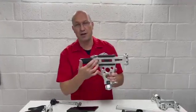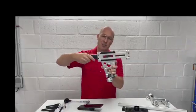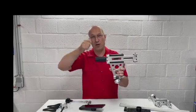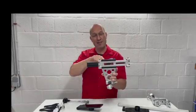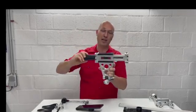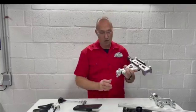There's a lot going on in this carriage — you can see the springs in here. The springs compress first while you are tensioning, and then on the end the spring keeps a lateral spring tension on the metal. So if you are hitting with a hammer or doing any manipulation — pushing or glue pulling — that spring allows the metal to move further and further out, keeping constant lateral tension. It works both ways: push or pull, you have that spring tension going on in both directions.